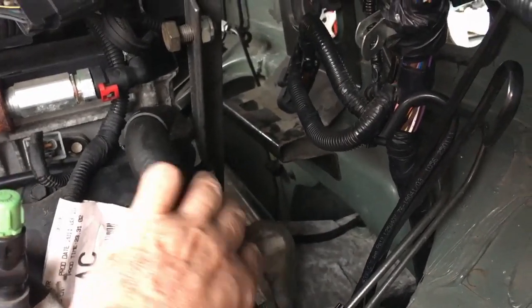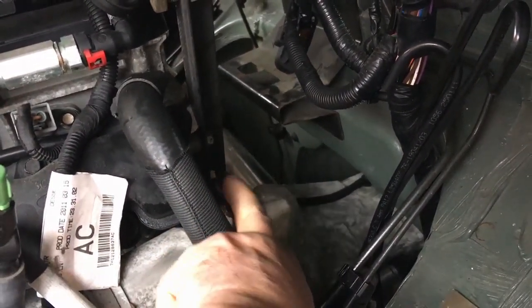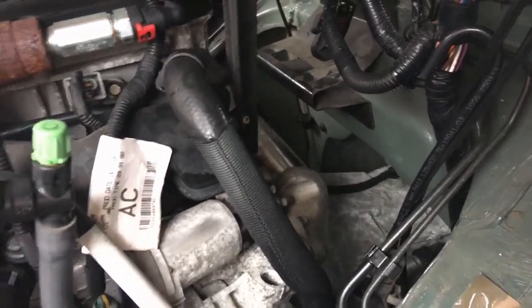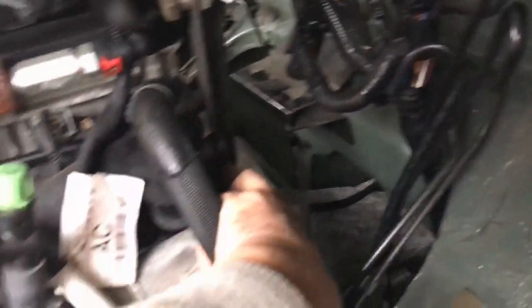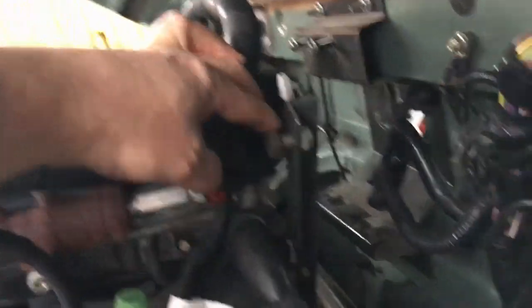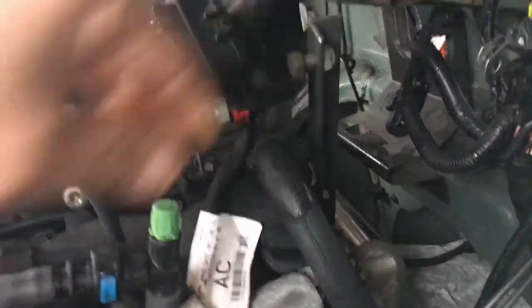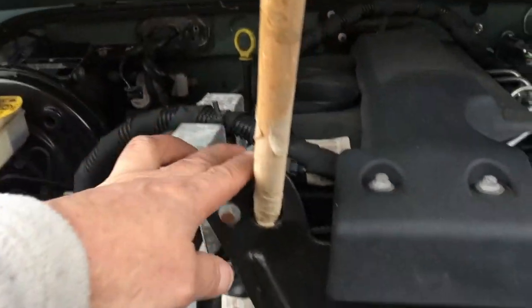You'll need some means of lifting the back of the engine. I've made this bracket - it's just a piece of inch L-shaped steel. There are two M8 bolts that go into the back of the head and those holes are 48.5 millimetres apart. You can buy a Transit engine lift thing for about 20 quid but I made the bracket myself. I've also got a 7/16th UNF bolt in there just to put the lifting eye on so it can swivel without twisting.